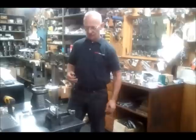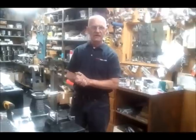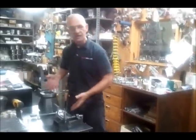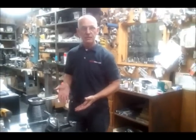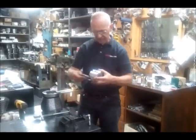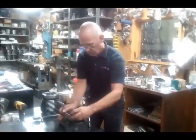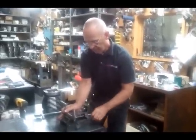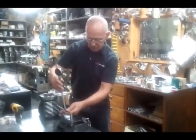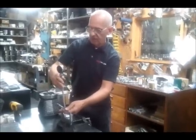Randy with High Performance here. I wanted to show you this is typical of what we see coming in for pre-fitted pistons. This is a piston and cylinder that came in pre-fit by the manufacturer. What I'll do first is mic the piston, then I'll set my dial gauge at zero off the micrometer.